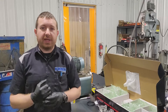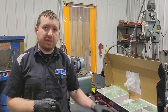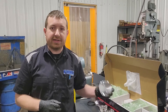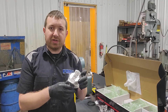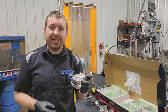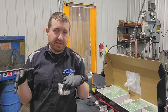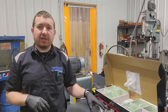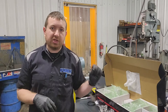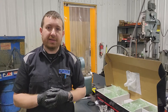Back on this Sleeve Gen 3 Coyote build. First thing we're going to do is check the piston pin clearance on these Diamond Mod 2K pistons. These things are a neat piece — they've got some really cool underbody structures. They rate these at 2,000 horsepower, thus the Mod 2K in the name. So we're going to check piston pin clearances first, then check the small end of the connecting rod for pin clearance, get the pistons hung and slap them in the short block today.